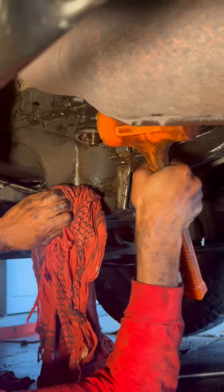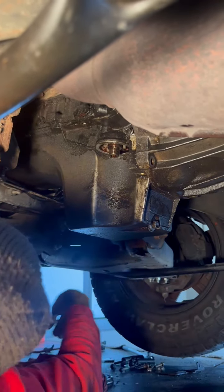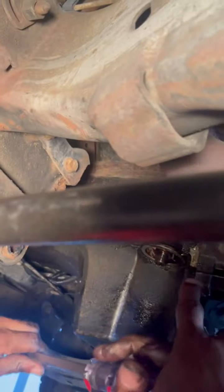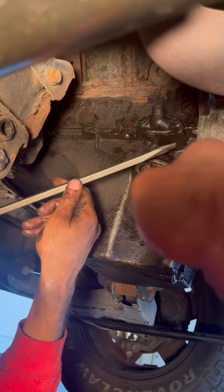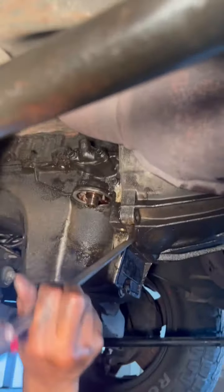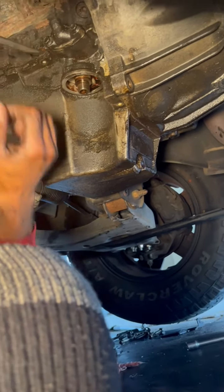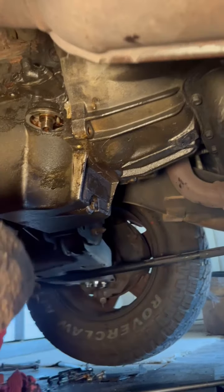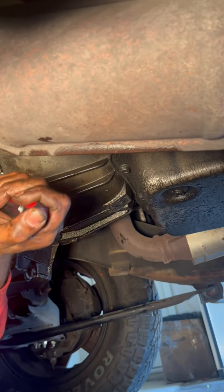Now here we're getting ready to drop the pan off the flywheel. There is one tip we could give you: there's a plastic guard, and there's a bolt in the upper right corner. There's a little piece of plastic here — we had to remove that plastic in order to access that final bolt in the corner. Pro tip — and I'm not a pro. We are YouTube certified, this is Keys and LB out of Phoenix, Arizona. I'm trying to pry it a little bit to get it to come down. Prying it would be normal since this is an '03 — it's not just going to drop off.